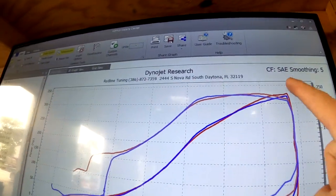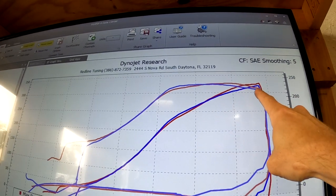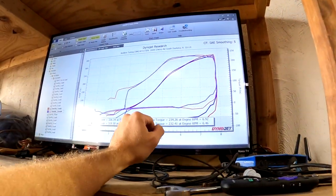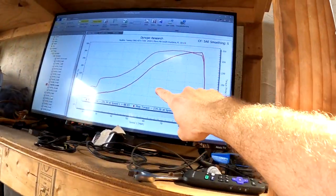Fueling is feeling much better now. I'm just out of fuel up top, so I'm not going to run it up that high — what's the point putting in more boost if I don't have fuel for it? That's pretty perfect. For Durhamtown I'll turn it down — that's a lot of power for a tiny machine. We have it at 326-327 horsepower; I believe the top run was 327, but close enough. That's at the wheel, so roughly 350 at the crank — not too bad for a 1.2-liter, 1,200 cc engine, same size as a motorcycle engine. Very happy with that.